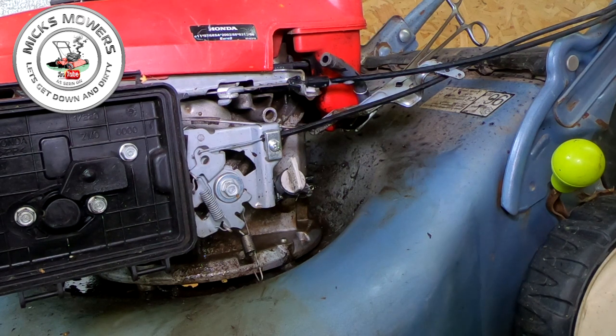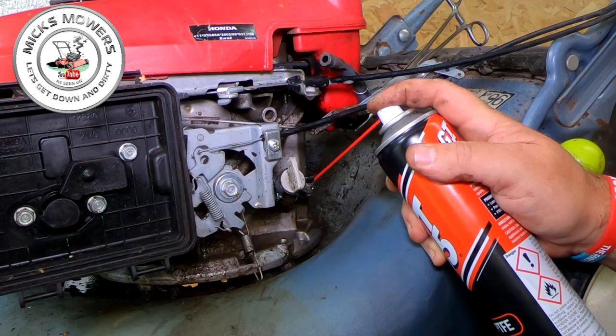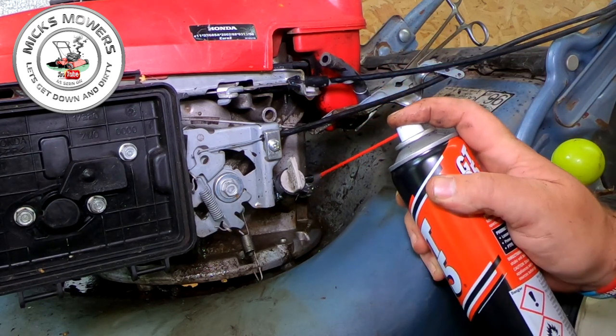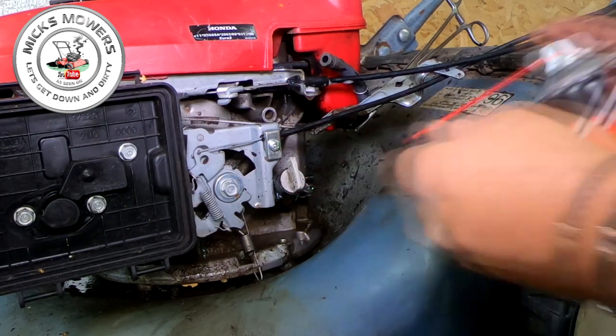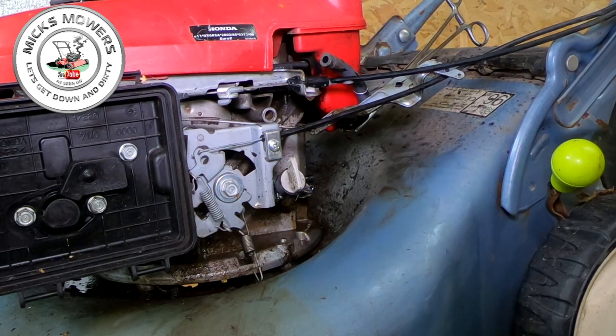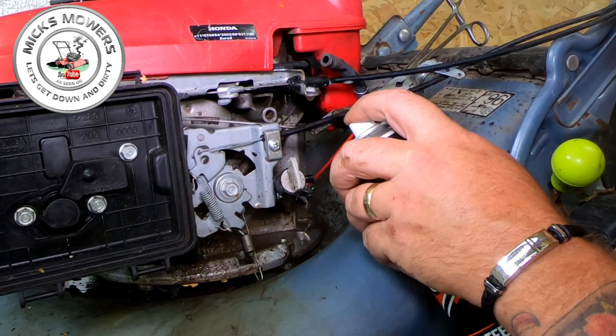You might be able to see inside there — there's a little tiny spring clip, and there's actually a void, which is where the O-ring should go. There's actually a place designed to take it, but they never put one in. They do on marine engines — on the Honda marine engines — but not necessarily on the lawnmower ones.